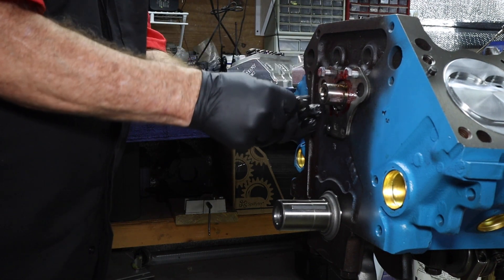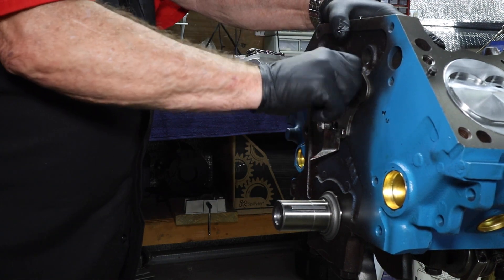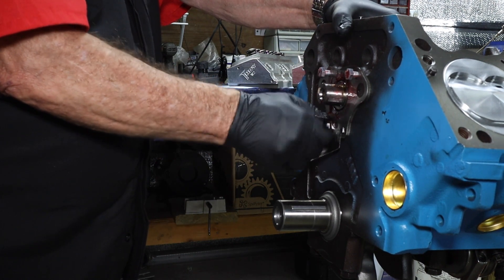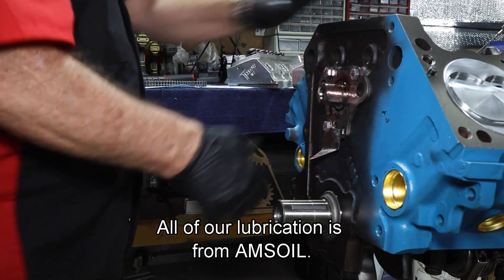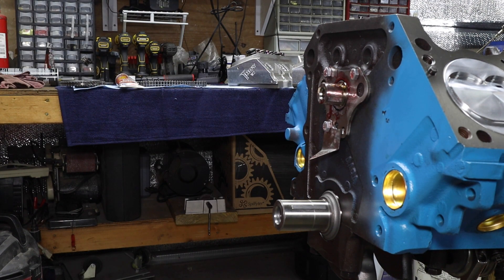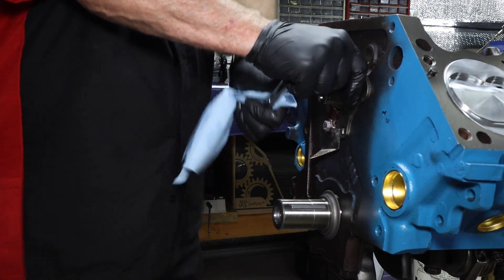It's time to get that thrust plate installed — not retaining plate. I'm still learning my vocabulary over here as the host and hobby guy. We're going to get this set in place so that the cam isn't prone to sliding back and forth. Notice the generous amounts of assembly lube on there. An interesting note: the key did not come with the kit itself, so we had to take a couple of extra woodruff keys we had in stock and grind them to fit into place — still standard woodruff keys, just modified to fit this application.